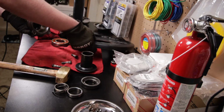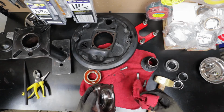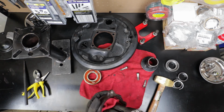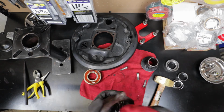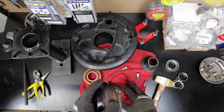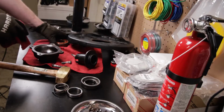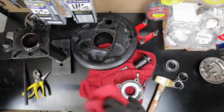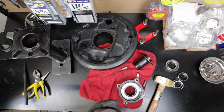You can see there's just a ton of gear oil in that, and on the bearing. Man, just a mess. So it's definitely those seals. I don't know if they were just in there wrong, but as you can see there, it was pretty shiny, full of gear oil anyway. I think this will just be another little part that I have for spare parts. Even this bearing, I don't know if it's still going to be good. I'll probably keep it just in case I have spares. It doesn't really have much play to it. It still feels really good.